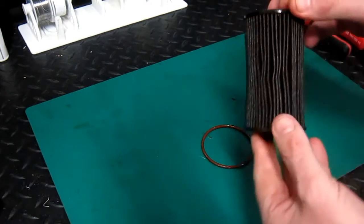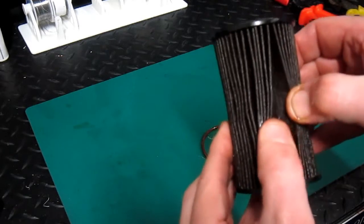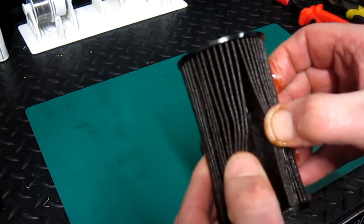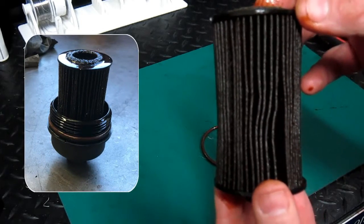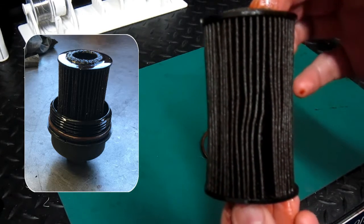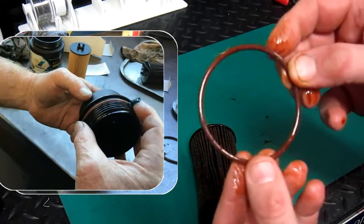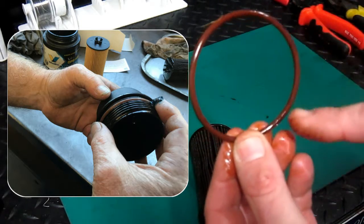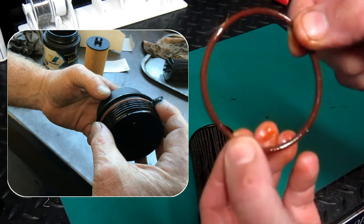Next is the cartridge type of oil filter. There's not much to say about these other than when removed, just check the pleats and make sure you look through each one and check for any iron filings, which of course would be indicative of an engine failure looming around the corner. If you look to the left now you can see what it looks like as it's removed from the vehicle in the cradle. The new one is placed in the cradle ready to go. What's quite important at this point is to take the brand new o-ring which is supplied with the filter and place a little bit of grease around the ring - that's going to ensure a really nice solid oil seal on the new filter.